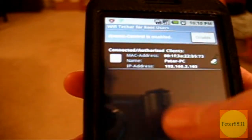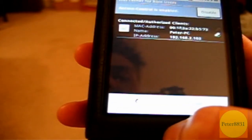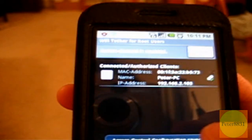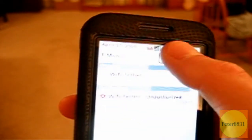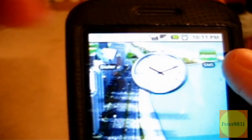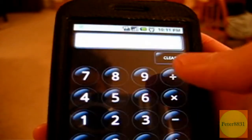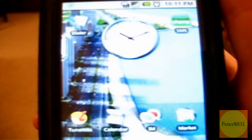Once you've allowed your PC or Mac to be fully connected with your G1, click on menu and click on 'Apply Settings' so it remembers to always allow your computer to connect to this router. You'll still have the tethering notification, but you can use the phone like a normal phone while tethering. You'll see the tethering icon in the corner, but you'll still have full phone functionality — I can use the calculator and any other apps. Go ahead and test out your internet connection — it should work if you've done everything right.